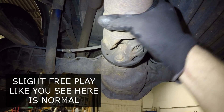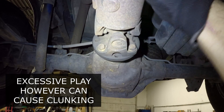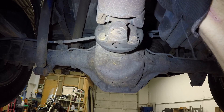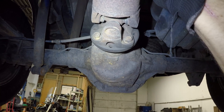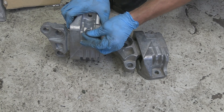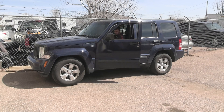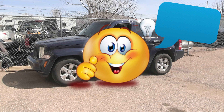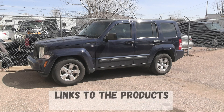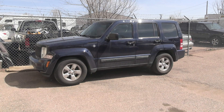The number one reason you may have clunking in a rear-wheel drive vehicle when switching between drive and reverse is free play in the differential. Stay tuned for more videos on this topic where we are going to diagnose and replace some motor mounts. If this video was helpful, please give it a thumbs up, share your experience and give feedback in the comments section below. Links to the products you saw in this video will be in the description. Thank you for watching, good luck and take care.